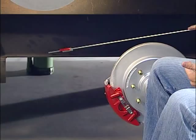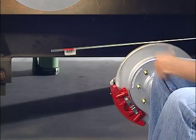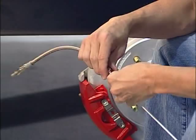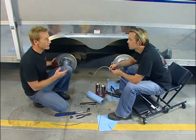Every time you've got a connector, you have an opportunity for it to leak and fail — you lose brake fluid and you've got problems. That brings us back to about this point here. We'll tee off another line the same way across the side of the trailer — quarter inch, same size — going across to the other side, then tee off with 3/16ths right about here, sneaking up to that end and down to that end. At the end of this, we'll hook on this flex line to route to each individual caliper. Make sure you use DOT approved flex line, because if you use a rigid line with floating calipers you're asking for trouble. This flex line allows the calipers to float and the axles to move, so you'll be covered. Phase one of our brake job on the trailer is done with the Kodiak system.